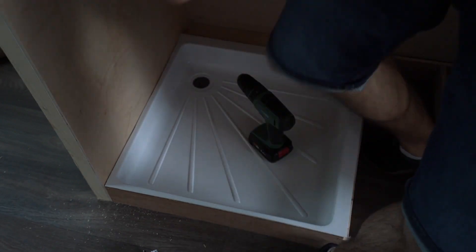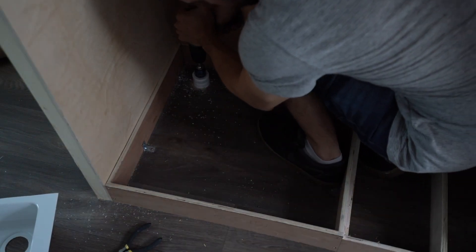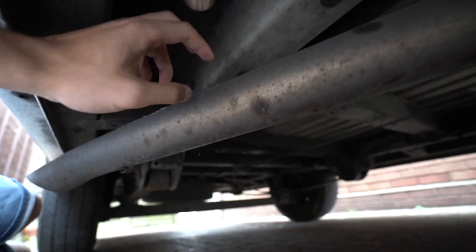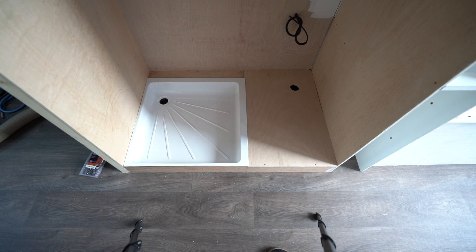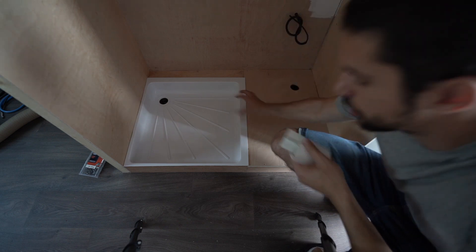Now we can draw the big hole. We got a massive hole in the van! I think we should be fine - let's check it from underneath. That's where it is - we've got plenty of clearance between the exhaust. So fingers crossed we should be good. I just put some underbody sealant around the hole and inside, so we need to wait for that to dry. While that's drying, I put the wooden panels back on. I haven't screwed this one back down yet because we need to do the PVC floor. But the thing is - how do we join the two PVC panels up? That's what's been bothering me for ages, and I think I found a solution.